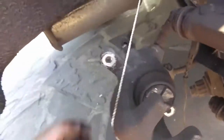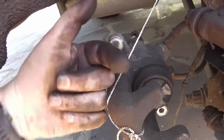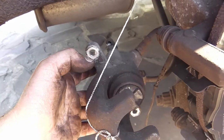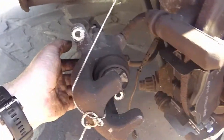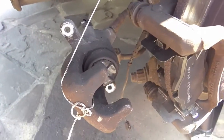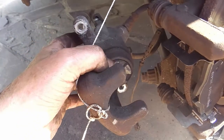When you put the brake on, brake fluid comes down here, pushes into this reservoir, and there's a cylinder in here which pushes out and crushes the brakes against the rotor disc, which stops the car. That's fine when you're just braking quickly because you're putting pressure on it. But when you park overnight and put the handbrake on, the hydraulic pressure can leak away, and if it was fully hydraulic, all of a sudden in the middle of the night your car starts rolling. So they keep the cable process working for the brake.